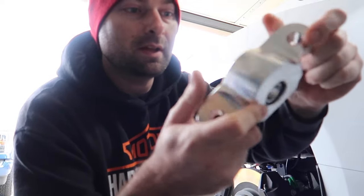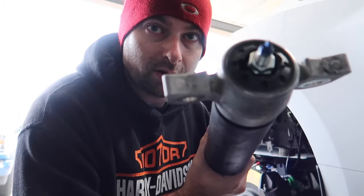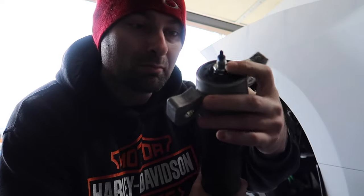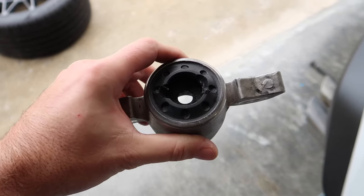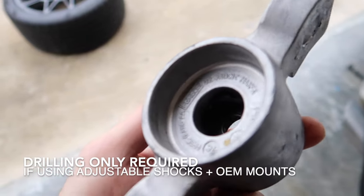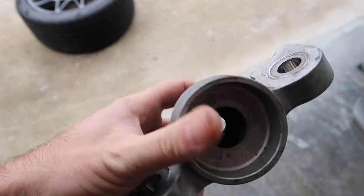It's like 30 degrees out here. So word of the wise: if you're going to go to the Pro Action adjustable version of the shocks and struts from Steeda, go ahead and get these replacement mounts. This is a much more hardcore component - you're going to have to drill out the top here. I bought a really expensive 30-drill bit for hard metal, and the problem is we messed up the rubber bushing inside. You can see all this play - it's mostly rubber with a little metal piece sitting inside that's now moving around because all the rubber has basically melted out of this thing.